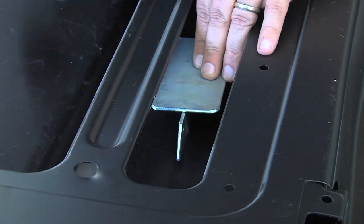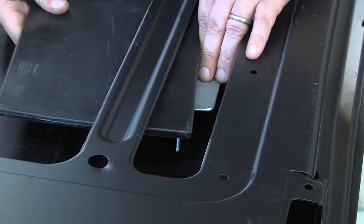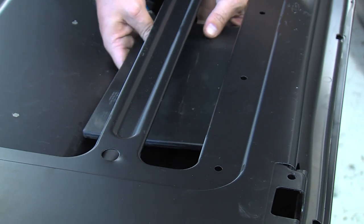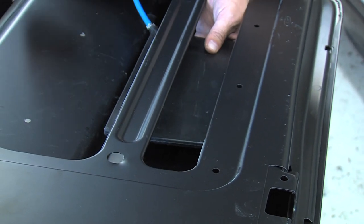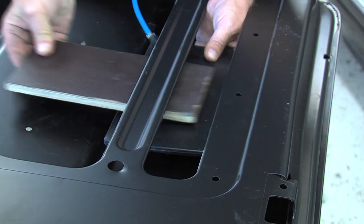The backside of the damaged car body panel first has to be stripped. Then choose which flat pad pillow is suitable depending on access and size of the damage. Sometimes it can be simpler to use two pillows at the same time.